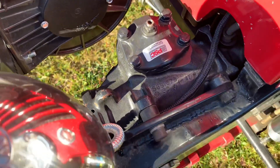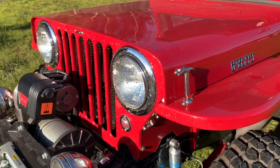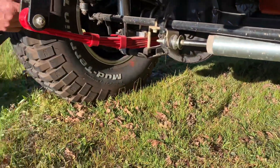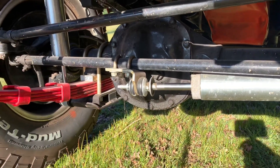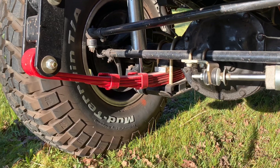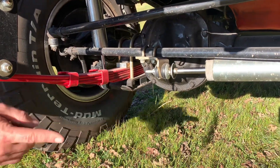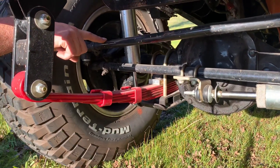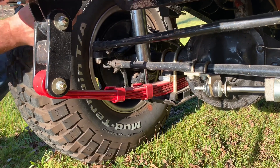With the frame extended and the bumper extended, it's the perfect spot to mount the Saginaw power steering, so steering is awesome in this thing — power steering off the Chevy 350. Peeking underneath, this is where it starts to get cool. This is a Model 30 CJ front end — probably early '80s or late '70s — with factory disc brakes. We went ahead and put a Bilstein steering stabilizer on there and flipped the drag link to the top of the knuckle so we could get it nice and flat with no bump steer.